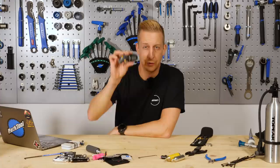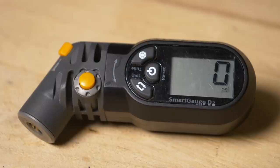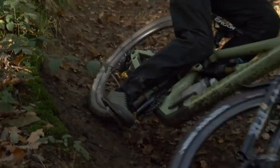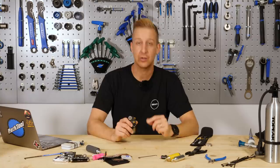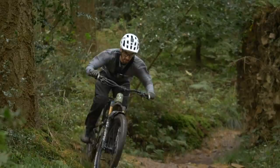Tire pressure gauge. There are loads of you who have never used one or don't know what pressures you're running. This is the way to guarantee free traction — go out and experiment with tire pressure and it will make your handling much better. You'll probably end up going lower than you've realized. Even two PSI can make a real difference. Once you find a pressure that feels good, go down or up one PSI at a time to dial it in, write down your base settings, and check your pressure regularly since tires do leak air naturally, in cooler environments, or if you have a slow puncture.